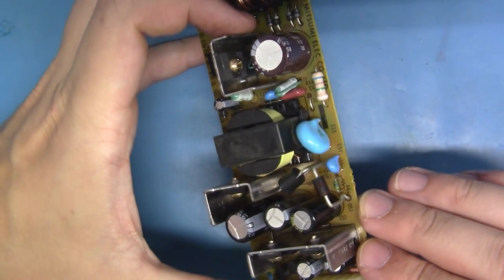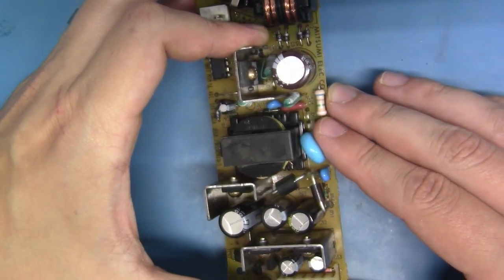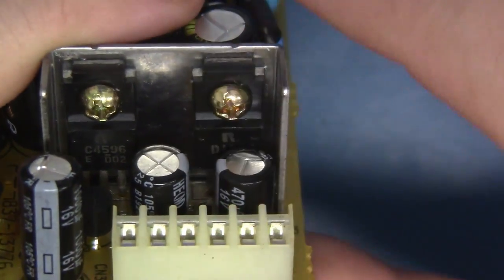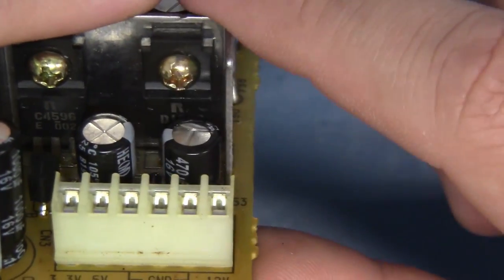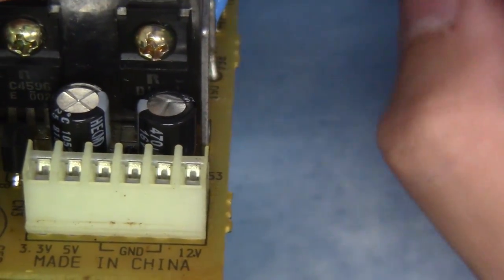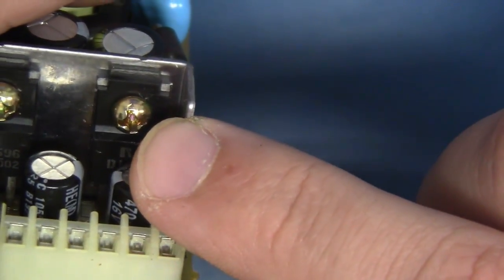There's one thing left to do with the power supply — removing a regulator that will help reduce the heat and workload so things run cooler and our GDMU runs just fine. In order to mitigate heat, I'm going to remove the 12-volt regulator, which is precisely what I'm pointing at right here. This is required if you have an actual GD-ROM drive, but because we have a GDMU, this regulator goes unused. With no real load on it since we've removed the drive, it creates a lot of additional heat. We can cool our system down simply by removing this. There might be a few rare peripherals that use the 12-volt rail from the AV port, but for the most part you won't be affected.